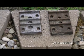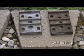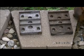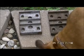And it looks like I have to just call it done for the day because I'm going to have to go and buy an oil water separator. It's kind of like the fuel filter you put in your fuel line, your truck, your car, whatever. It separates all the water out of it. So I'm going to have to go buy one or two of those. I've got to put them on the line to get the water out to stop this from happening. It's just way too irritating to stop, clean it out, put it back together, start sandblasting, and 10 or 15 minutes later, take it apart and do it again. It's way too annoying. So I'm going to just wrap it up for the day.